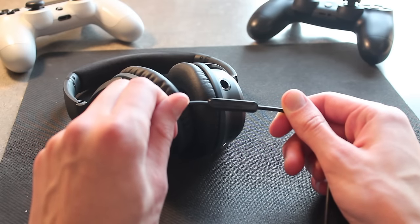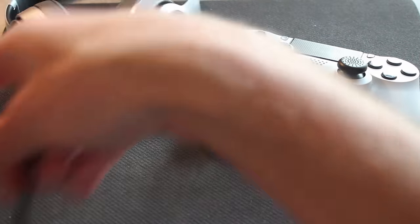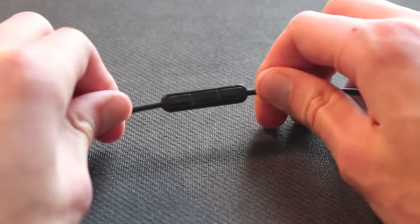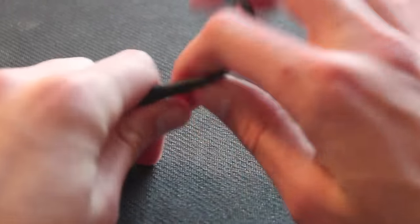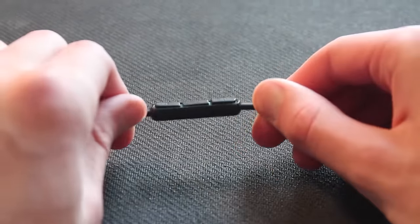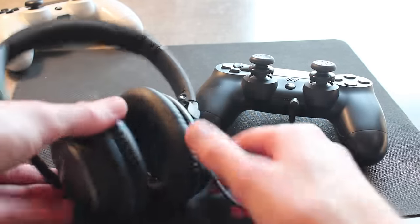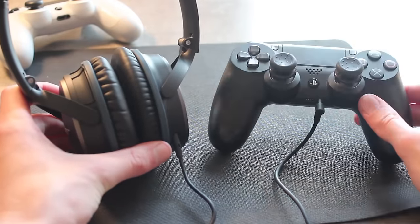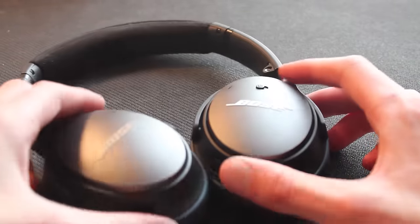If you use the cable that comes with the Bose QC25 headphones or the Beats by Dre headphones — really any of the Beats — you'll probably experience when you plug in the cable into your PS4 controller that the inline microphone does not work. You will receive audio through the headset, but you will not be able to speak with anyone. The reason is that Sony has implemented measures to mute inline microphones that use the Apple standard 3.5mm inline microphone, because Apple's EarPods make a horrible high-pitched whining or ringing noise. So now all headphones that use some type of inline microphone are being muted by the PS4 software.